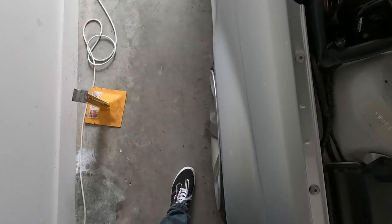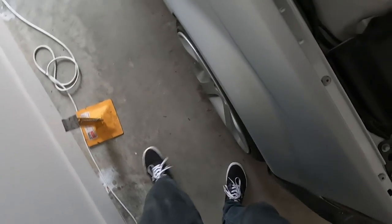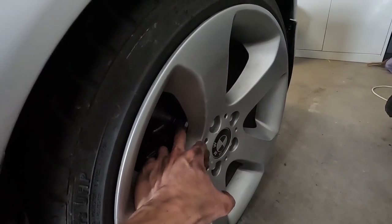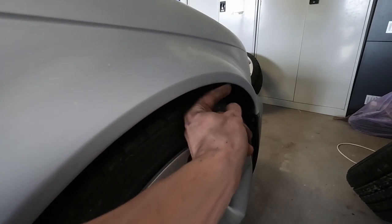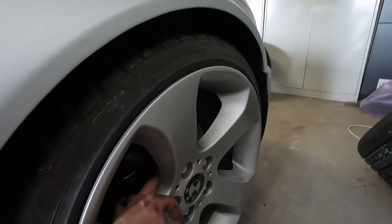Now I'm going to show you on the fronts. The fronts are pretty close rolled to unrolled, because they're just well-designed — unless someone has half-rolled mine previously. This is my 19 by 9 plus 48, and you can see it's pretty much on the edge there. Now when I've tucked in, I've cleared it. I'm also running an 8 mil spacer on these, so they're technically a 19 by 9 plus 40. And they clear in here — so plus 40, you can clear — and that has a 10 mil thickness there until you knife edge it. On the other side, I've knife-edged it and gained myself that 10 mil. So you could go to a 19 by 9 plus 30 in the front.